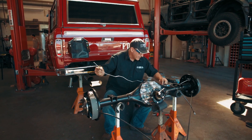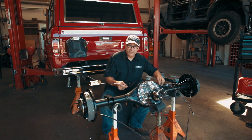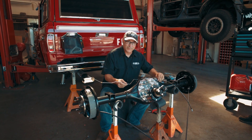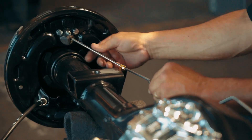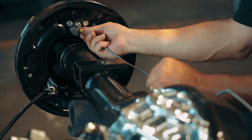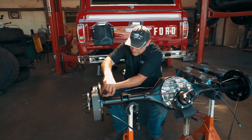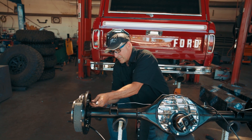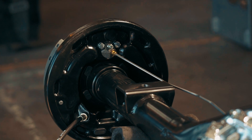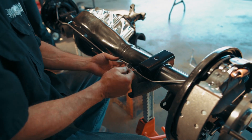Now we've got our long-side stainless hard line, and I'm going to start by just getting it hand-threaded into the rear hose. You want to do it by hand and make sure everything's spinning nice, because it's easy to cross thread this stuff. Same thing for the wheel cylinder side — keep it loose, keep it loose of tension; the tension can all come later. If you feel like you're cross threading or it's getting too tight too fast, back it out so you don't mess this stuff up. With those just loosely hanging, I'm bringing the lines out because I know the U-bolts are going up there.